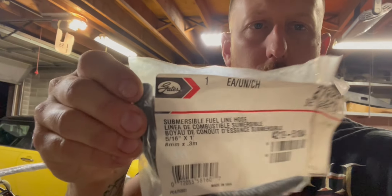Clearly the fuel line AEM provides with their in-tank fuel pump is not submersible — why would they even send a hose you can't use? I'm moving now, going to cruise real slow and hopefully make it home. Gotta find submersible hose. I got the fuel line replaced — it's this Gates submersible hose, part number 27093, for 5/16 hose if you guys need one in the future. Apparently this exact same thing happened to my friends too, so AEM just ships the wrong hose. I'm going to make another pull to make sure everything's still okay before the roll race tomorrow.